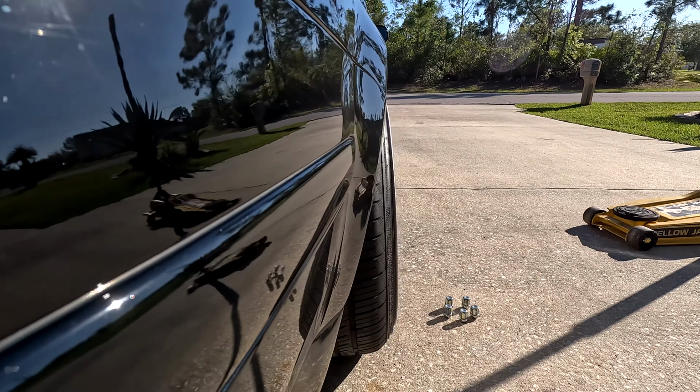Ooh, the rear came down a lot more, oh my gosh. Oh, it's so close. Look at that. That's terrifying, but that's fully aired out and it stops right there. Exactly what you want. We've got to just get the front to drop a bit more. Because the rear has the rake and it pulls the wheel forward a little bit, this corner up here towards the front is very, very close, but dead center is, I would say, about a half inch higher than the rear. So a bit more adjusting to do with our fender liner, and I think we'll be perfect.